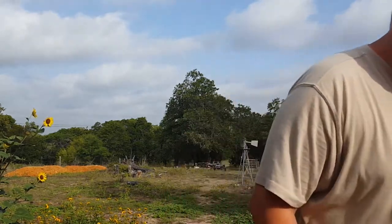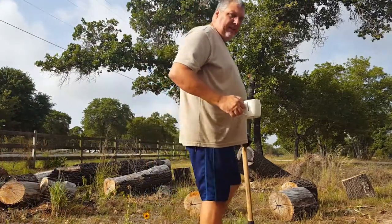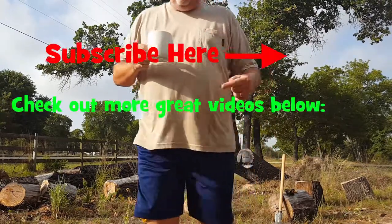What happened was it got pinched in a log, the log fell and pulled the chain off. Anyway, it ended up being flooded, and thanks to Fish it's fixed now. It's a really old post so I doubt he's still around, otherwise I would have left a message. To recap: spark plug out, let it dry out for a day, put it back in, and it should fire right back up. As always, thanks for watching — I'll do things the old-fashioned way, the only exercise I get.